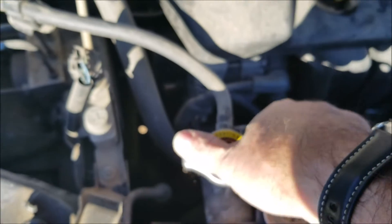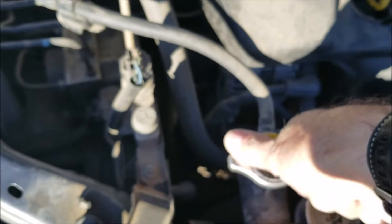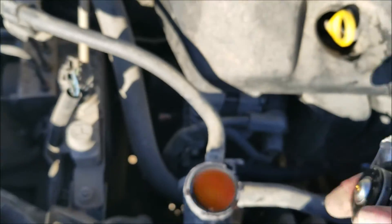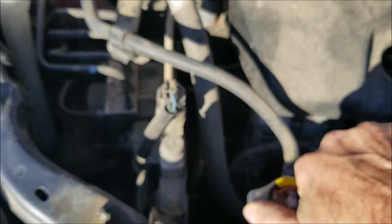You don't want to check it at the radiator cap. If you want to check it there, make sure it's cool because it'll be under pressure — you'd just pop this cap off and pop it open. But that's not where you add or check it. Where you add or check it is right here at this overfill jug.